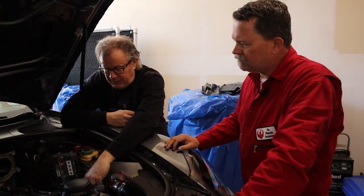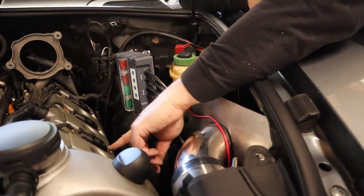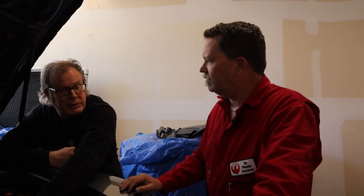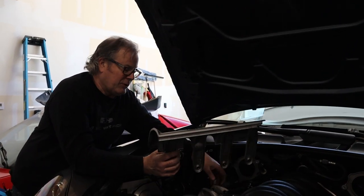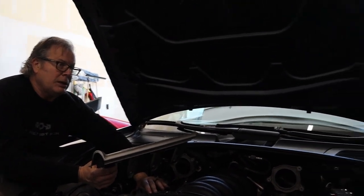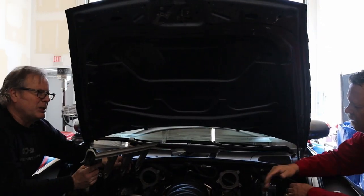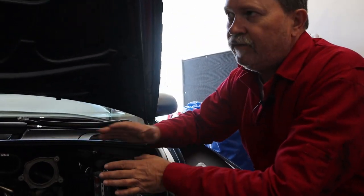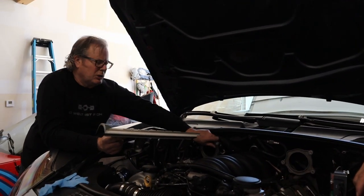Part of the challenge with this whole project on YouTube is slowing down the progress so you can see what's happening. These are the fittings that hold down the beauty panel covering the coil packs. One challenge is that sometimes they get a little tight - they run down into the bolt that connects the coil pack to the car. We may have to reach under and grab that with pliers to make sure it bites. We removed the torque arm and just slide them up to take them off. There is some finagling since they fit underneath brackets, so wiggle carefully.